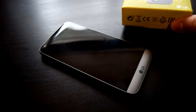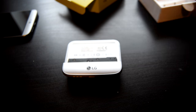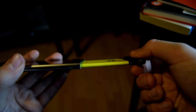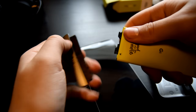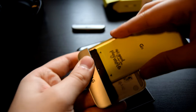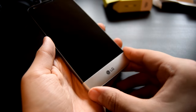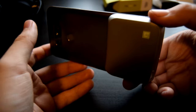The G5 has a mechanism which enables you to change the bottom part of the phone with something called Friends. These are modules that have different tasks or enable a few features. To change modules, press on the lower left side button with your fingernail and the bottom part will be separated from the phone. Then just pull to get the module out, remove the battery — which requires a bit of force — and then insert that battery into the new module and slide that whole thing into the phone. It's pretty easy, although you have to use a lot of force when removing the battery and it kind of feels like you're breaking it.